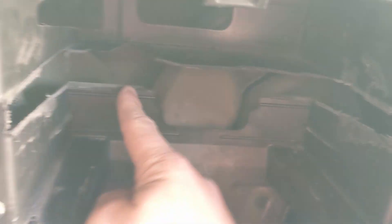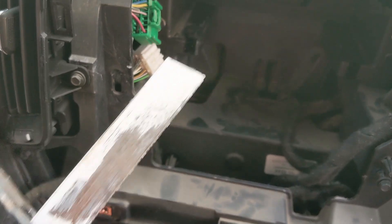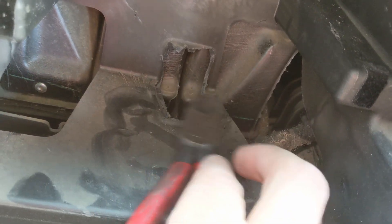As you can see inside this cavity, in order to get our new double-DIN radio in here we're going to have to cut these support bars — but not the bottom piece, because that's where we're going to be pushing the OnStar module. I didn't film this because I was experimenting on the best method, but ultimately I took my Sawzall with a metal blade at low RPM and sheared it off on each side — be super careful because there are a ton of wires going through here. Once it was pretty much off I bent it down and started snapping it, then used wire cutters to cut and snap the rest off. I did the same thing on the bottom with a horizontal Sawzall cut, then cut and snapped the pieces out. Now it fits quite nicely in there.